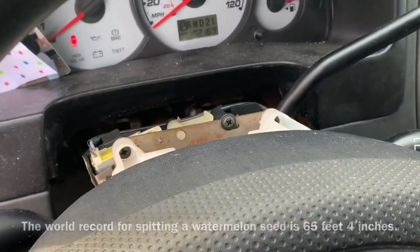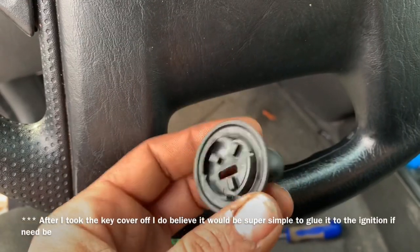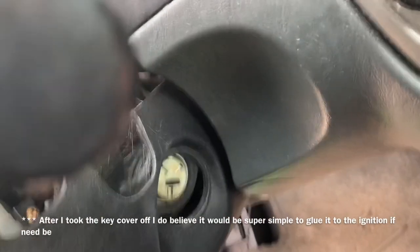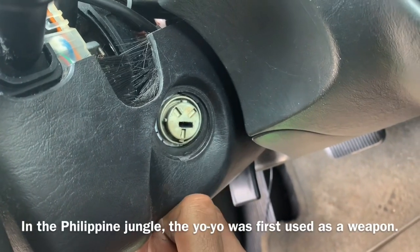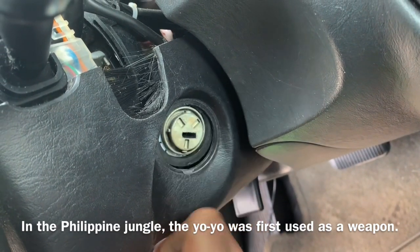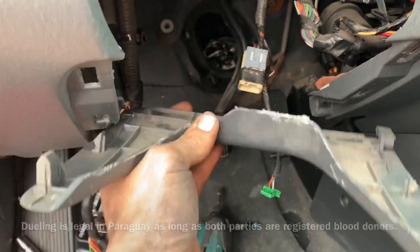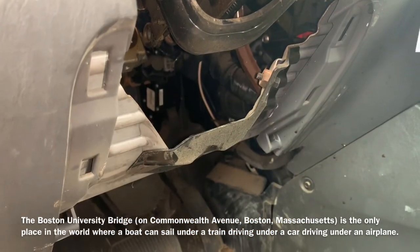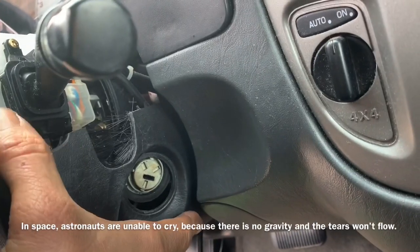You can turn it sideways and pull it out. For the bottom cover, take a flathead screwdriver — looking at the cover we can see it's affixed by three tabs that hold it onto the ignition. I placed my screwdriver in position and popped it off. I can't promise you won't break the ignition cover, but you can't break what's already broken — this is broken and we need to service it. If your vehicle has a brace, it'll be easier to remove it after you remove the plastic cover. It's not 100% necessary to take the brace out to get the steering column out.